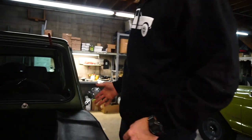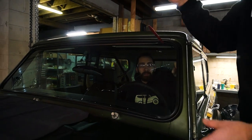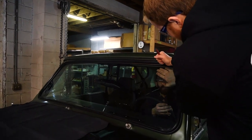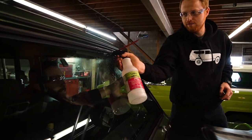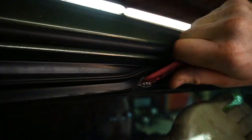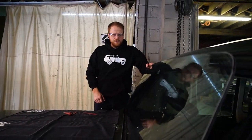I'm struggling so I'm going to have Tyler come help me. He's going to push from the inside as I work the seal from the outside. We're trying to save this seal — normally you would just cut the seal and the glass would pop out, so if you're trying to reuse an old seal this is your struggle and it's real. We'll use some soapy water to help lubricate that seal a little bit. After lots of hard work we got the glass out — Tyler's going to help me lift it up and out of here.